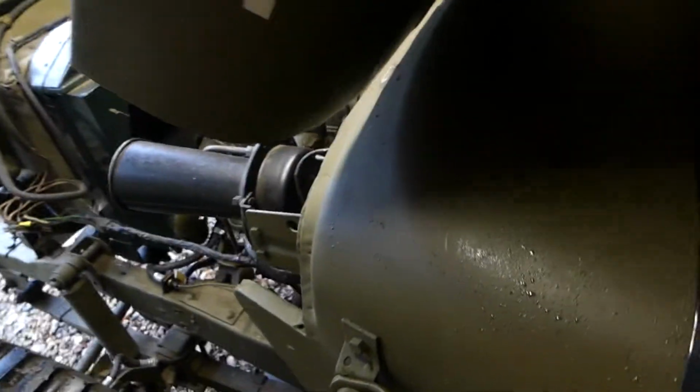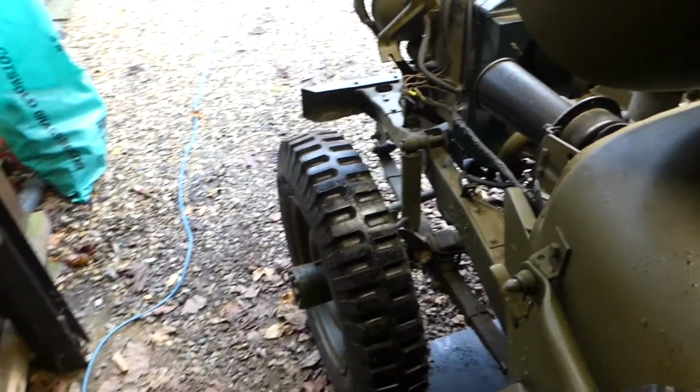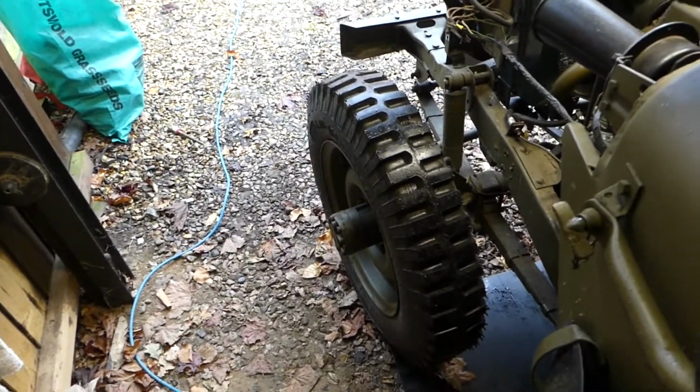So, what else did we learn? The cover needs to go back on the inspection port, because otherwise that's going to cause some problems. But basically the steering's too tight, so you can put this on a full lock. You see here, if I turn it that way, you see that wants to spring back a bit. If I turn it the other way, which is where the problem is, it's where it's got a tight spot, see that don't want to spring back when you're going that way.